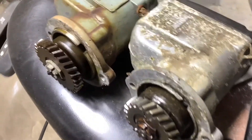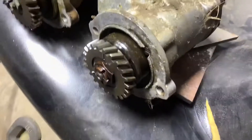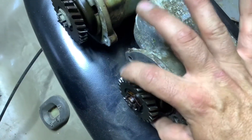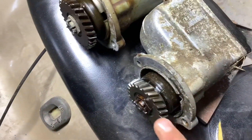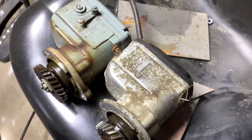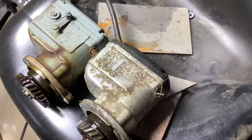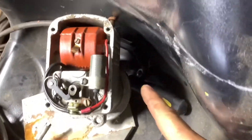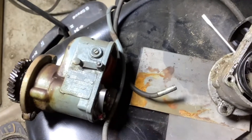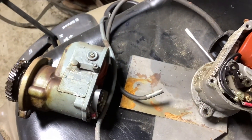There's the X — that's the mark on this timing gear. The inspection cover is actually on the front over here, so the timing gears match up. But this smaller engine had a smaller gear on it, so I'm going to see if I can swap these gears out — put that gear on this magneto and we'll be good to go. For the sake of the kill switch being on the inside on this one and the outside on the other, and the fact that these internal parts are the same, I'm just going to take these internal parts that are giving me spark and put them into this case that is not, and then I should have spark.